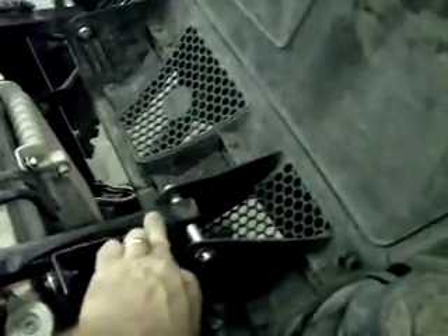First of all, you want to remove these zip ties here on this cabling and get those out of the way, then loosen up your bolts on your oil coolers, top and bottom. If you follow the lines down there, it goes hard line all the way down to some short rubber hoses. You'll undo those rubber hoses — we provide you with enough rubber oil line to run it all the way down. They go to rubber just below the coolant reservoir bottle, then go on to hard line just above that.